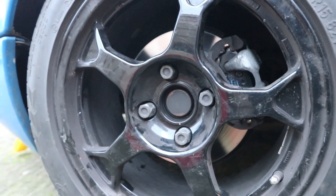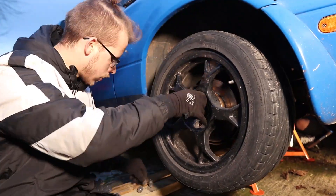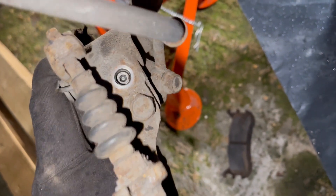Quick update: the front brakes are done. Laura kinda put on the toe strap. We're gonna do the rear brakes now. Basically what happened last time is I couldn't rewind the caliper — I thought it was seized, but upon my research, I'm stupid. There's a little bolt and an allen key that you use to rewind the caliper — I'll show you, it'll make sense. Front discs and pads, both sides done. Discs and pads are on — it was very very easy actually.